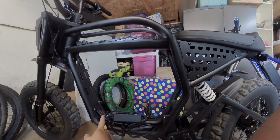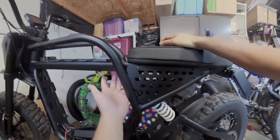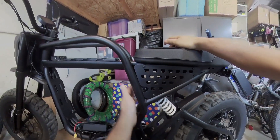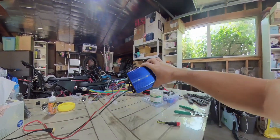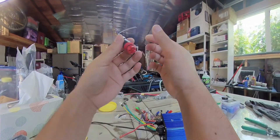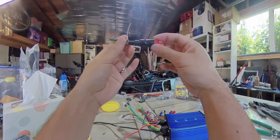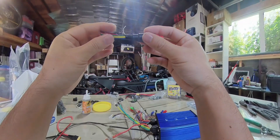I think it's pretty smart to cut it off here. That way there's enough wire length for this to go where you're going to be placing it. In this case, I'm going to be placing the controller up here and there's going to be enough wire to connect with the stock motor wires. In this video, we're going to be using this Yondi controller, $70 on Amazon. Here's the wire that I cut off, and again, here's the white wire that's going to return back to the original controller to detect speed. This way, you could use your own display for the speedometer and mileage.